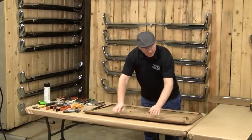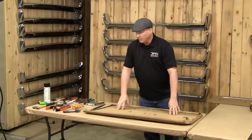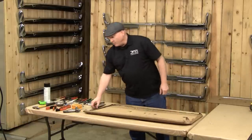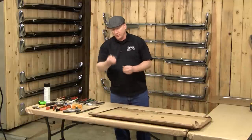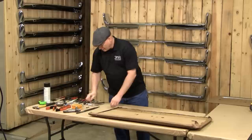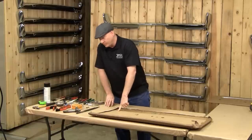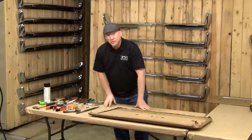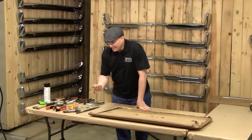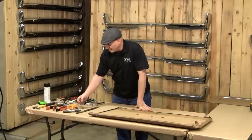The next step is to finish up with the staples on the back of the panel and to put the beltline trim strip back on. What I figured out is how to use standard T50 series staples, cut them down to size to a little bit under one eighth of an inch, and have them work on the panel without going through the other side and puncturing your vinyl. They do make upholstery staples that are the right depth — I couldn't find them anywhere. I understand they are online; you have to buy them in bulk and have the proper upholstery staple gun. That's a lot of work.